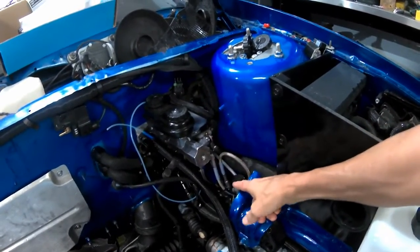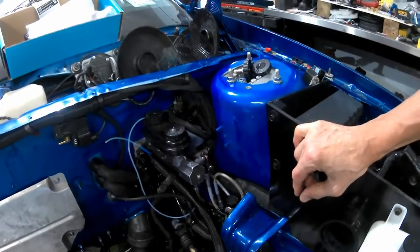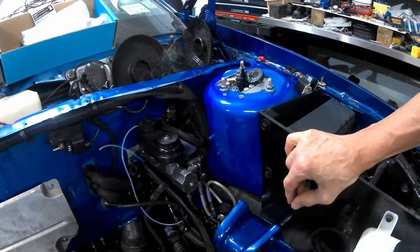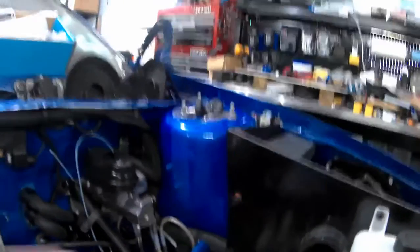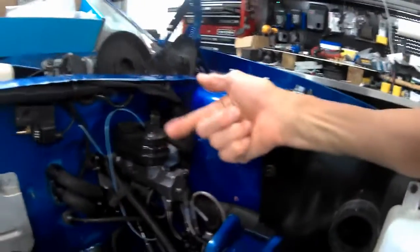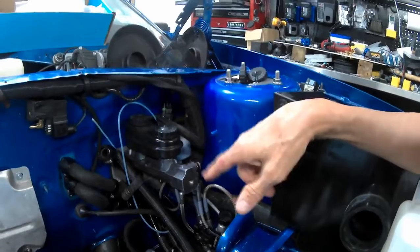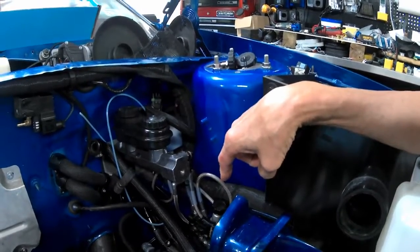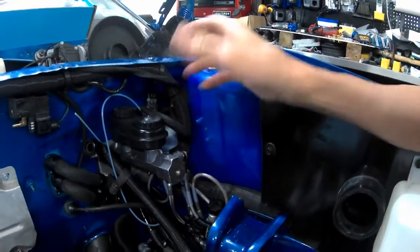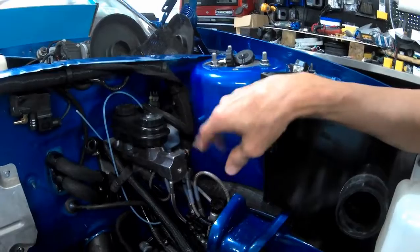I've got it set up right now so that this is the front and this is the rear. You go into the prop valve and then you're going to throttle the rear down so that it doesn't get as much pressure as the front, because the fronts are bigger. Right now I have no brake fluid coming through the passenger side front, so I'm trying to troubleshoot that. I've got good rear, and I've also got one line going to the rear instead of two separate lines — I'm only running one back out of the prop valve. I've done that before without a problem, but just keep in mind you're getting the same pressure to both rear brakes instead of the prop valve playing games with everything.